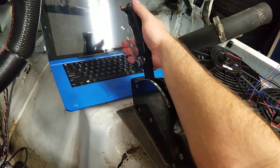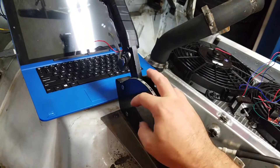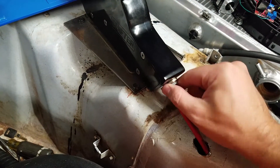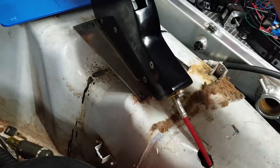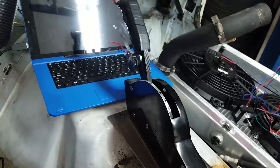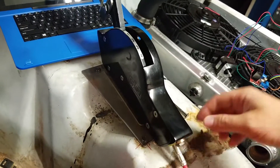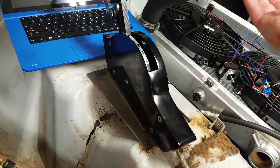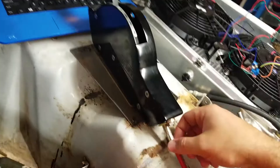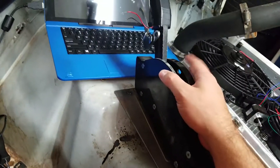Hopefully by the time I post the next video I'll actually have the box mounted with the actuator in it, and I can show that it just actuates the shift cable right here where it is. I might move it to the front because right now it's set up as a pusher-style system, but this came with brackets for a pull-type cable, so I had to redo everything. I basically took the brackets on the trans and flipped them upside down 180 degrees. I'll be able to fix that because I don't like the way they are right now — they bind up pretty bad down there.